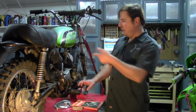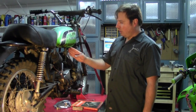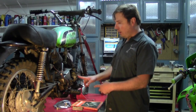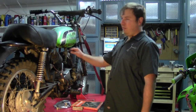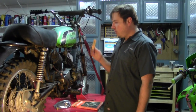Going forward, we're going to tackle the fuel system — meaning cleaning the tank, cleaning the fuel shutoff, replacing fuel lines, cleaning and doing some preliminary adjustments to the carburetor, changing some fluids. We're going to check for spark, and if there's problems there, we'll have to diagnose that. Another thing you need to have on hand is a brand new spark plug.